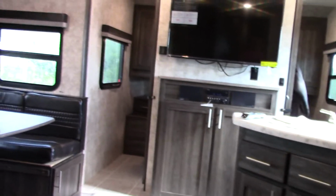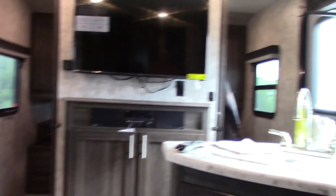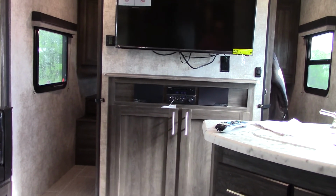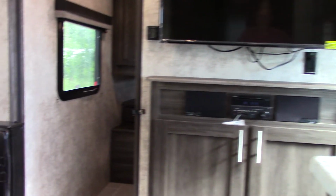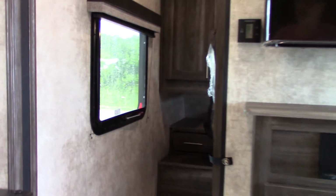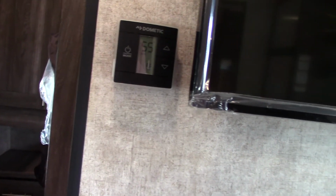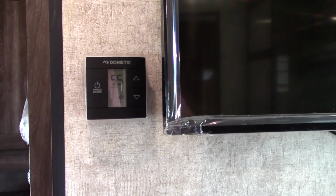Okay, so thanks for purchasing your trailer at National RV Detroit. And remember to inspect your roof 3 times a year minimum. And also when you winterize your trailer, you have to bypass your water heater. So if you don't know about that, you have to educate yourself a bit on that.